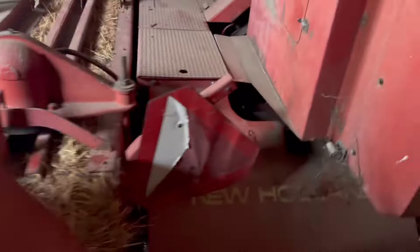Nothing yet. We'll crawl down here and look again. See if we got fuel in the bowl. No fuel in the bowl yet, so that is not ideal. I can't remember if this thing had an electric fuel pump on it — I thought it was just a mechanical pump. But nothing in that bowl yet. Tank is where? I can't remember. I'm going to do some more digging.